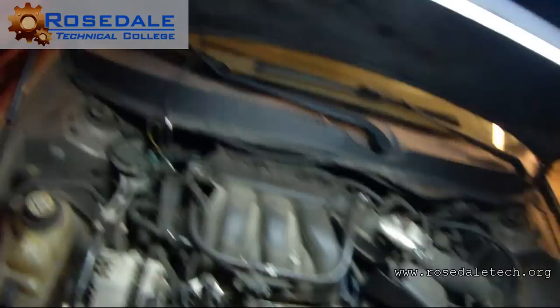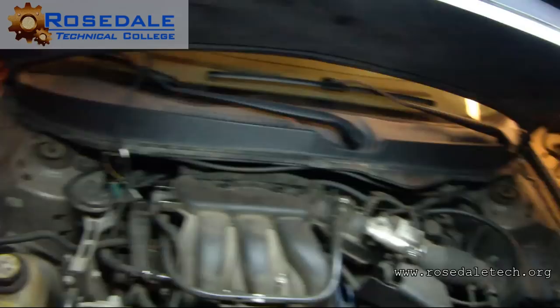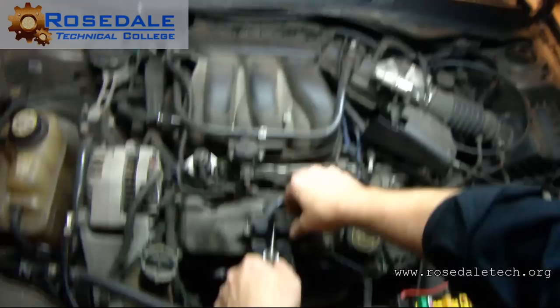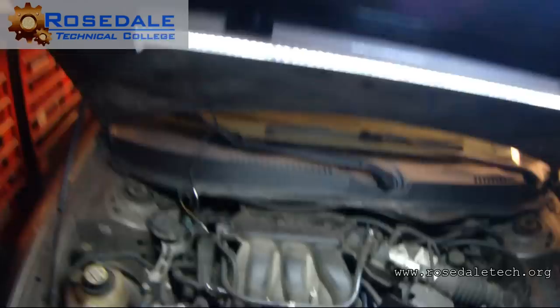Let's take a listen. Listen. Good spark too. Those two are not contributing. The first thing I would do if I was in the field, seeing newer plug wires on this, is think someone was here potentially and reversed them. Probably not, but it's worth a shot.